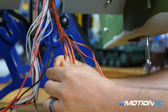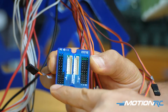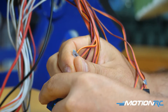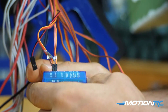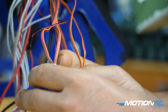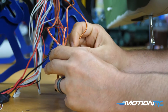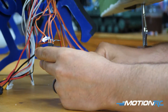You will see two rudder leads - that's for both rudder servos on this twin boom aircraft. Those get plugged into the blue box. Mind your polarity: positives go to the right when looking at your blue box. Put your rudders into the two rudder ports. Then you have two landing gear leads for both main gears coming out of each boom. You'll have two open gear ports left on the blue box since your nose gear and nose steering are already plugged in, so plug in a landing gear in each open port.